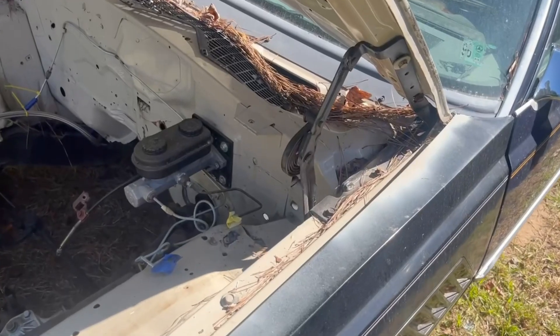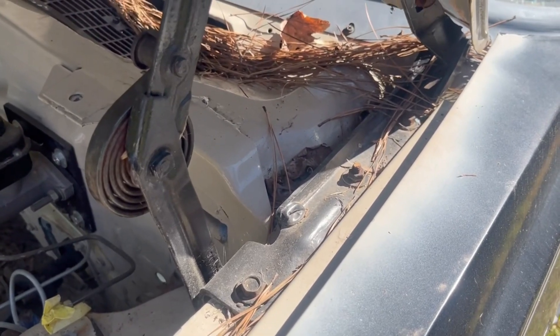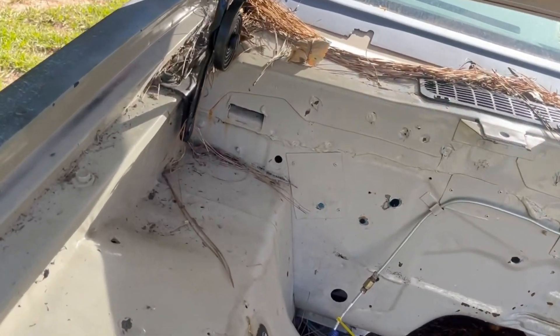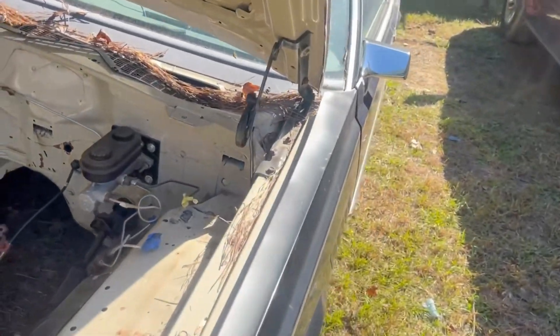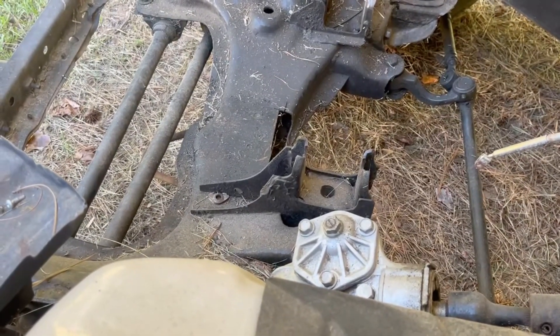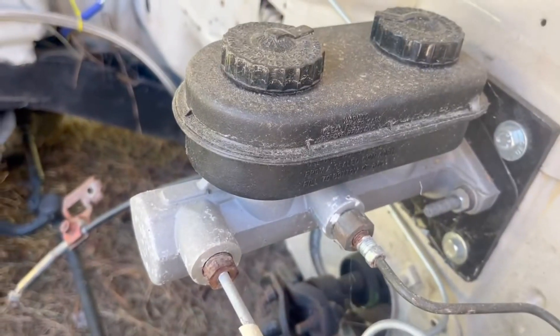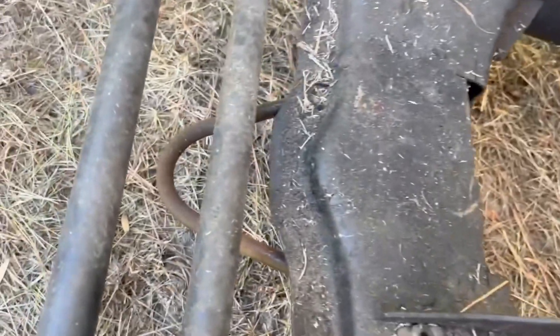I came out to the parts car and noticed this car here — the guy was in the process of restoring it, making a race car out of it. These are already black and they're much cleaner, so I'm going to pull these off and use them, and put the old ones on the shelf as spares. That'll save me some time. I'm getting ready to take this K-frame out — it's a J-body so transverse torsion bars. He was making a drag car, so he had a lightweight master cylinder with no booster, an aluminum steering box and adapter. I'm gonna put all that stuff in the Cordoba. Swapping the whole K-frame over — it's got new bushings, tie rod ends, and all that stuff, and a neat little tie-down bracket he welded in.